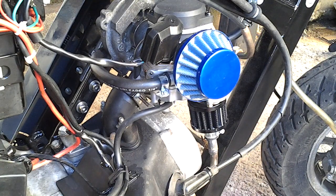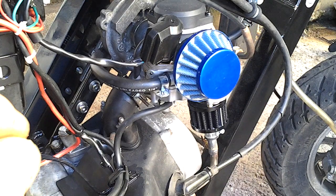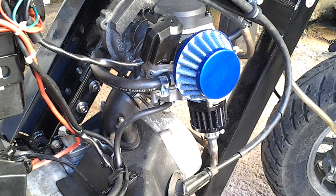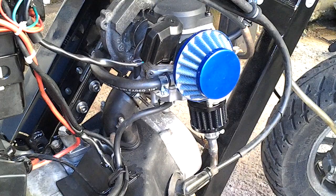Also, because it's drawing more air into it now, that pilot jet is just not sufficient enough to provide enough fuel with the greater volume of air. I've had problems with this type of carb on just stock scooters — they need up-jetting because they just don't idle, particularly the closer you get to sea level. Greater volume of air, you need a greater volume of fuel. I'm not sure why they stick such a small jet in them, but it can be a bit of a pain. It doesn't seem to affect the 125s much because they use a bigger jet, but certainly on the 50s.